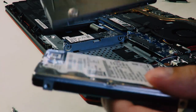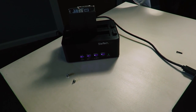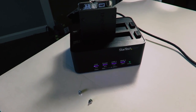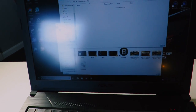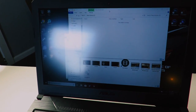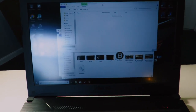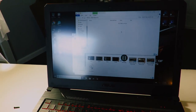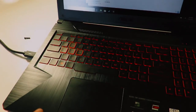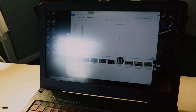I'm going to put it into the cloner right now. I just ran into a bit of a problem — apparently the cloner didn't want to do its job; it didn't recognize either of the drives. The cool thing is you can directly plug it into your laptop. I had both drives showing up, and because it's not a boot drive I can simply copy the files over. Now I can access both drives and copy the folders over, so I'm going to do that now. It shouldn't take too long, and after that we can put everything back in and put the SSD in.